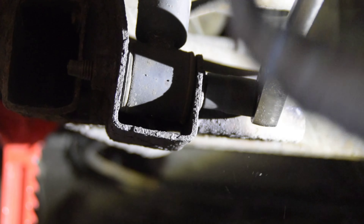Now just the two 10mm bolts on the actual shock itself. The old springs sit on these isolators - just pull them out if you no longer need those. The coilover itself will go in place of the actual old isolator. I'm going to quickly put this on - just need two hands to make sure it's seated correctly. It will have a little rubber seat just so there's no metal contact. We've got the adjuster fitted now and we're going to offer the shock up.